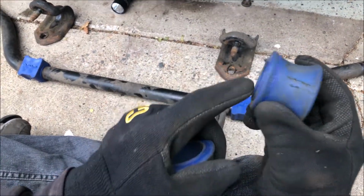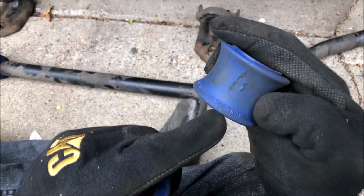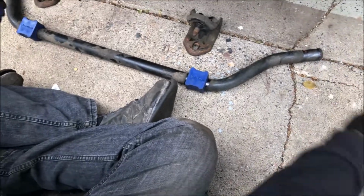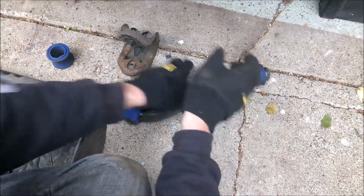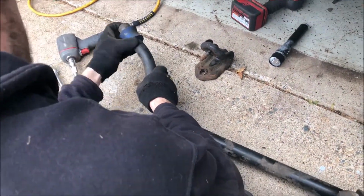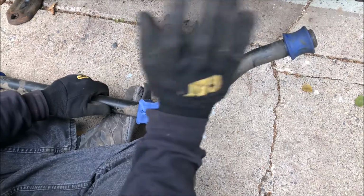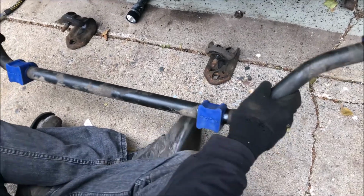Pay attention, because on these ones, which are also Moog, I'll post those in the description like I said, it says install this side first, so make sure that you're putting them on properly. So when they say first, I assume they mean from the end. As you can see, they're not the tightest fit. Like I said, my sway bar is a little worn out, but I'm not going to do anything with that. I don't feel like buying a new sway bar. This will help quite a bit in itself, just because the factory ones were junk.